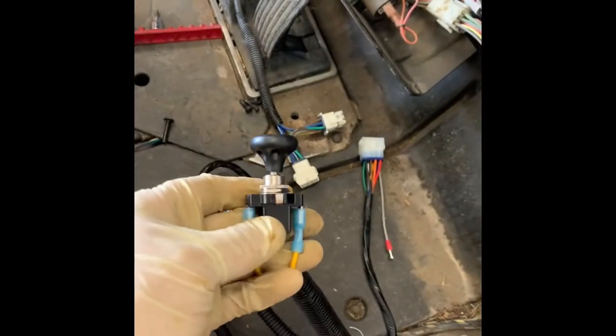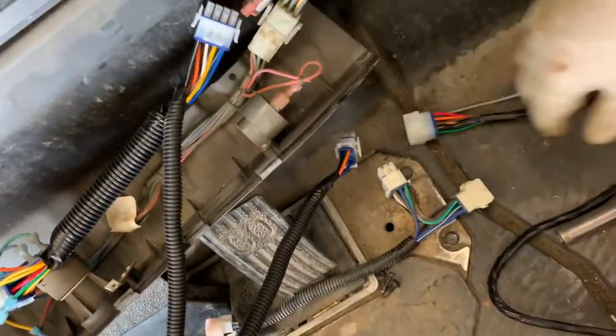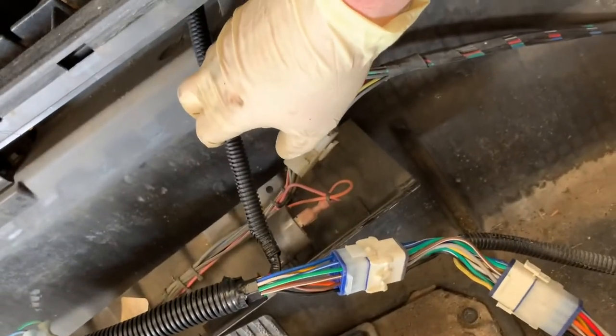Before we get everything wired up, let's put on the on/off switch — super easy. Just twist this off, and you have two screws right there. Take it off, slide it through the hole that we drilled earlier, then put this back on to snug it. Now that we have the light switch mounted to the dash, we're going to plug in. There's a little channel down here — push this through with your headlight wire, then plug in the voltage reducer harness. The headlight harness is going to the front and the voltage reducer harness is plugged into the bucket harness running back into the battery tray.